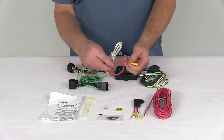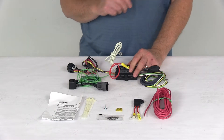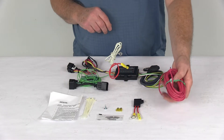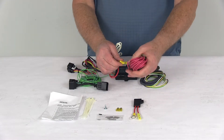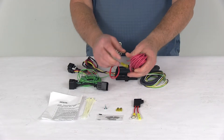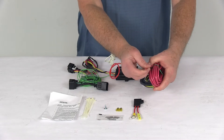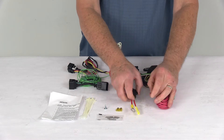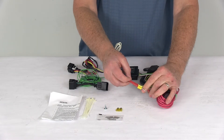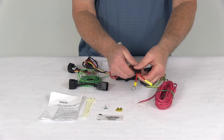The other wire is the red power wire with a butt connector, and it needs to run to your vehicle's battery. They include an extra length of wire that connects to the power wire — connect one end there, then run this wire all the way up to the front where the battery is. You don't want to connect this directly to the battery; first run it through the inline fuse holder. Connect one end to the fuse holder with the butt connector, and the other side, which has the eyelet, connects to the battery.